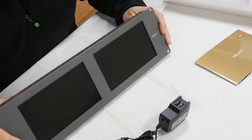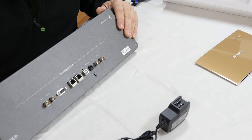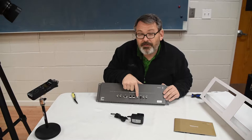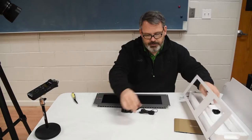There are the two monitors. On the back, this is Ethernet in and out — I'm assuming it has an IP address and functions in tandem with the ATEM. We'll find out how that works when I look at the manual. There's a traditional tally connector, SDI in and out for channel monitor two, SDI in and out for monitor one, and USB — likely for installing firmware.